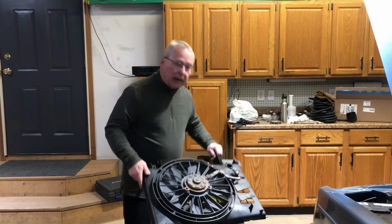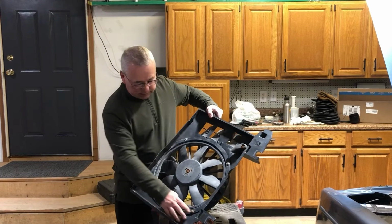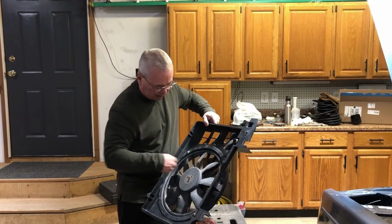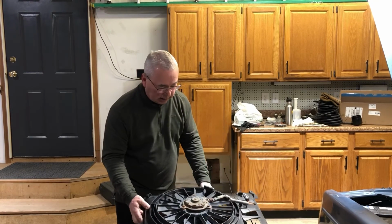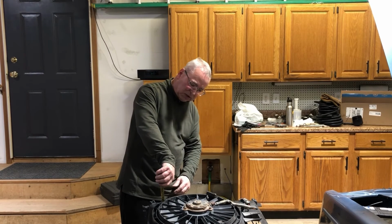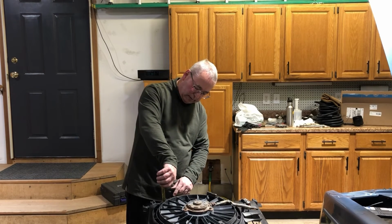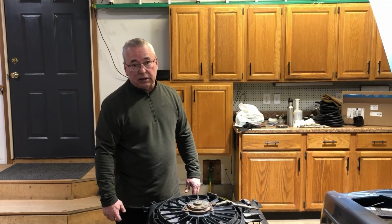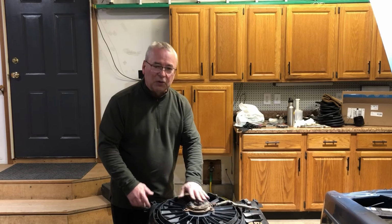Well, there we have it. I got the last of the screws in, and they go right in pretty nicely in the original mounting holes. And remember, the slots are at the bottom. So this is the top, that's the bottom. You mount the fan facing the same direction it was, and previously we measured that and it was a bit over 2 inches protruding from the face of this, and now we're at about 3/4 of an inch, maybe a little less. So if we were at 2 1/8, we've gained at least an inch, if not 1 1/4. Definitely worth doing, and it's free.